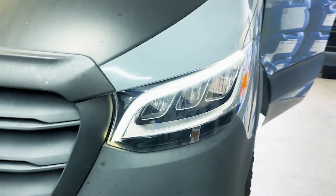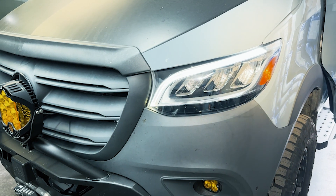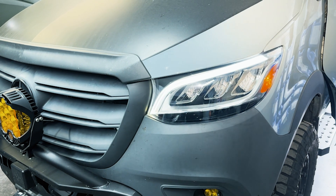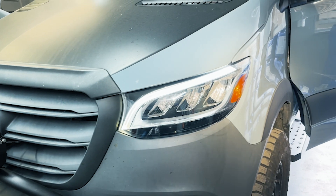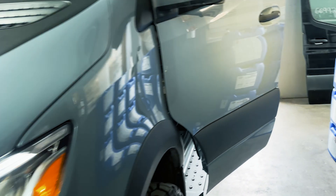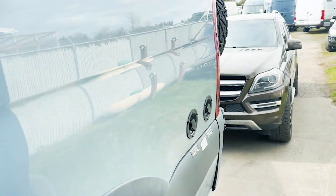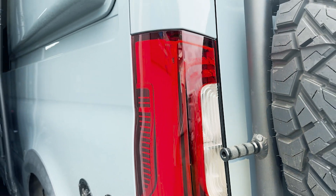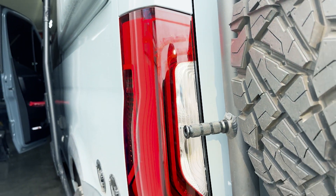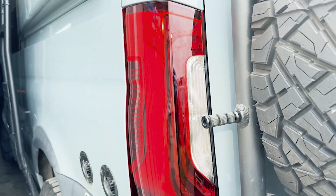You will not always see that result right away, because sometimes there will be no lights whatsoever and they can only be enabled with the computer. Also worth mentioning about the rear lights: the rear lights will be working, however they will throw fault codes and will need to be programmed as well. They are not plug and play — meaning they will also give you fault codes.